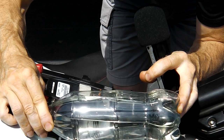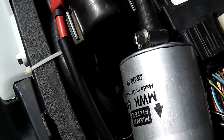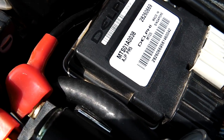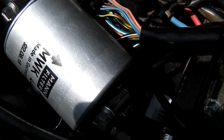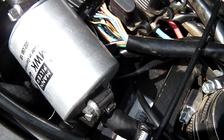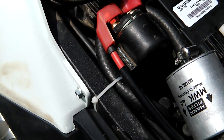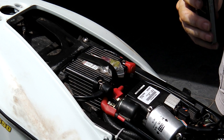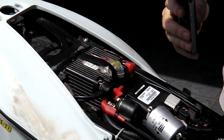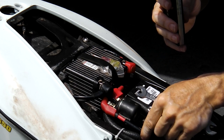So the air needs to go out. If we look at the fuel filter, the hose is coming out of the fuel tank here and it goes around the starter relay into the filter, then out of the filter and goes to the injector. Somehow we need to get this fuel filter vertically and pump some fuel through it. Normally you would do this during the installation of the fuel filter and not after you've installed it all nicely, so I need to take a few things loose to get some more space.